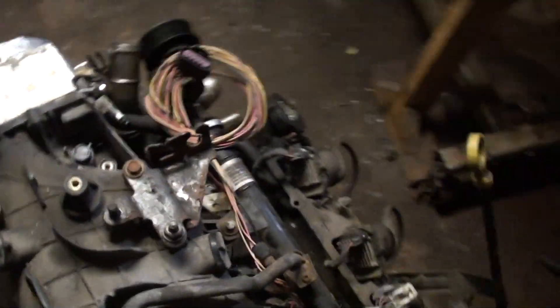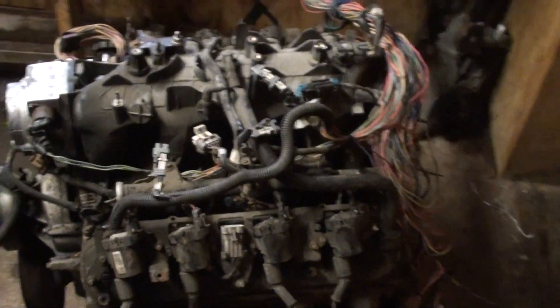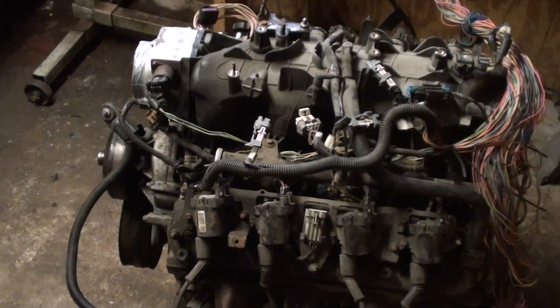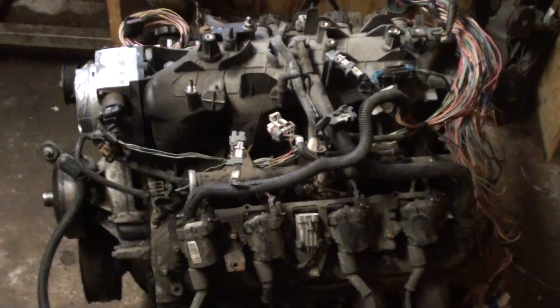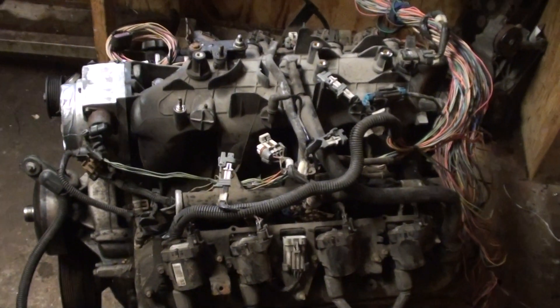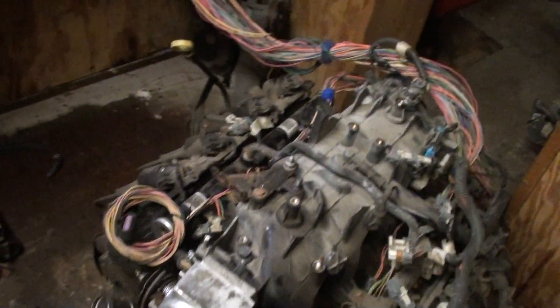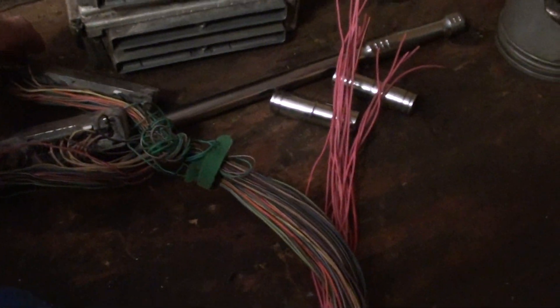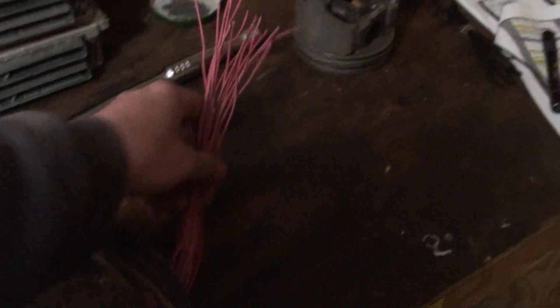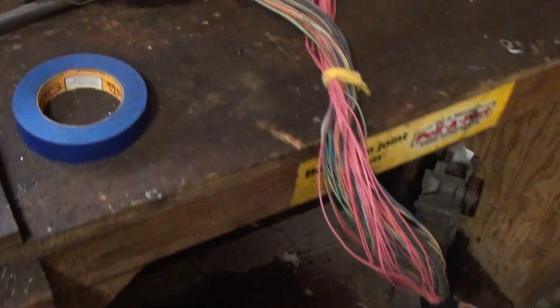You've got your oxygen sensors and your grounds. I'm coming along, though I still want to do quite a bit. I'm going to do some shortening and neatening. I want the harness to be as simple as possible but as effective as possible. On the Olds build — one of the first harnesses I did — it was functional but still a bit messy with random wires poking out. With this one I want it really clean. You get your connectors for the computer, all your key 12-volt leads, your two 12-volt constants, and I'll show you how to make a fuse block — I already posted that in a previous video.